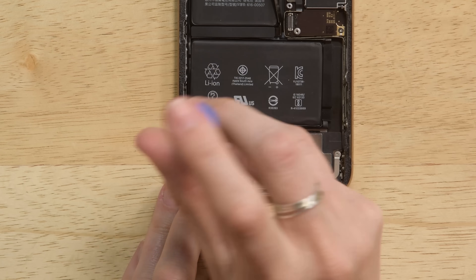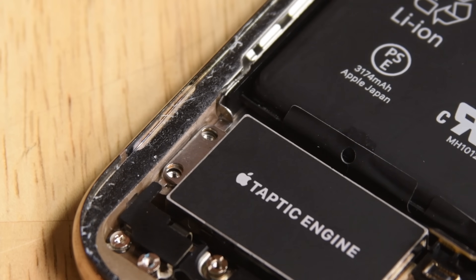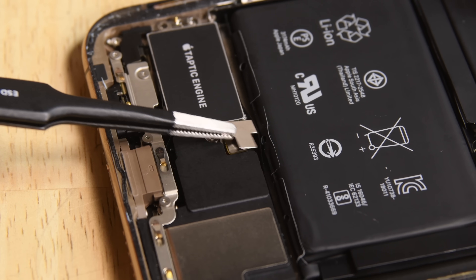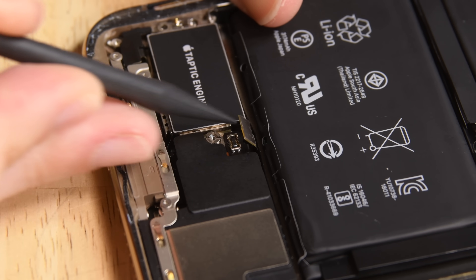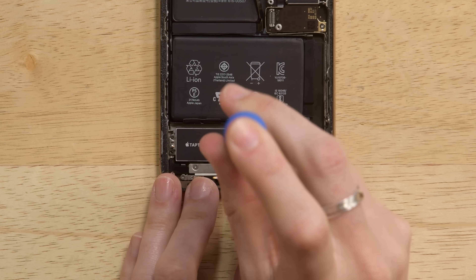You don't want to lose the ground piece because you'll need it when you reassemble your phone. Grab your tweezers and remove the plate covering the connector — make sure the plate is flat and push towards the battery to release it. Once the plate is off, disconnect the cable under it. Right below that connector is a standoff screw; remove that next.